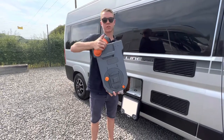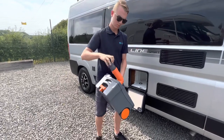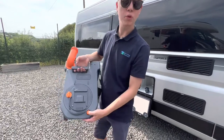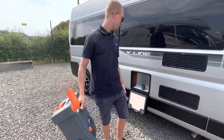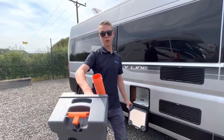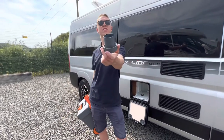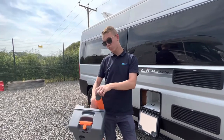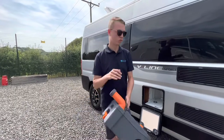To empty, remove the cap and press the orange button when emptying the cassette. Once emptied, there's normally a tap — put a little bit of water in, give it a rinse, tip out again. Then fill with a capful of liquid — either the blue liquid or the green — directly into the cassette, and then it's good to go back in.